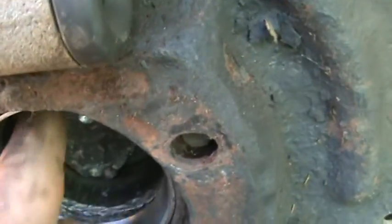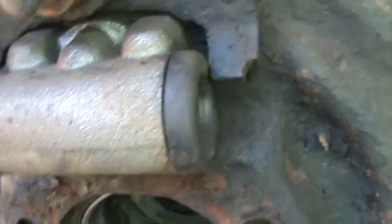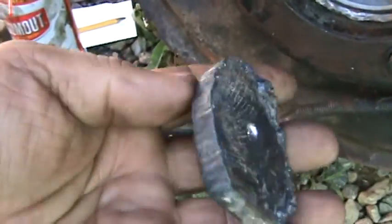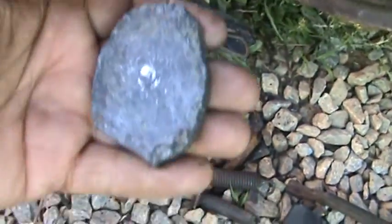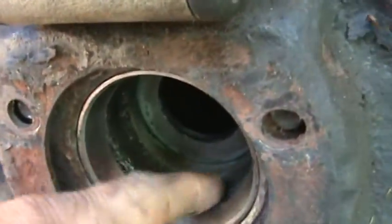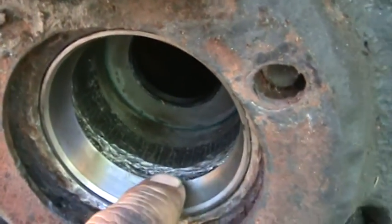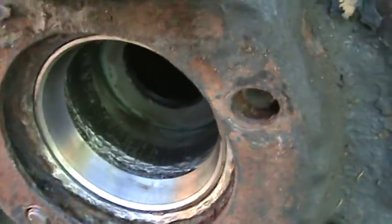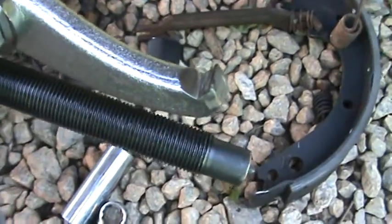This is my little plate — I made a backing plate against that seal. I took a piece of metal and torch-drew a little hole for my puller. They put a new seal back in here, but they just done such an awful job. I'm gonna have to pull all that out, reclean it, and straighten that out. I had to make some modifications to my puller.